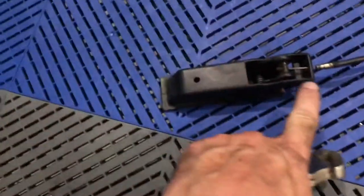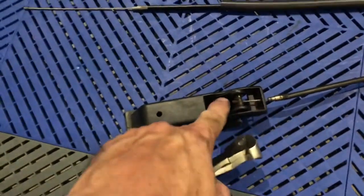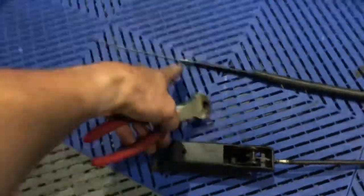Quick pause to show everybody what I'm doing here. I've got the cable laid out on the floor — the inside-car end on that end, and the part that goes to the actual trunk release on the other end. There is a C-clamp pin that goes up into the cable housing, but this one is frozen up in the cable. So we're going to cut it and move it over to the new one, put the C-clamp on, and run that line through.